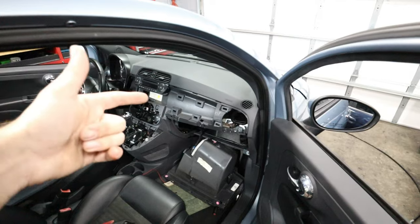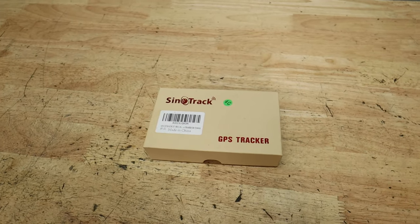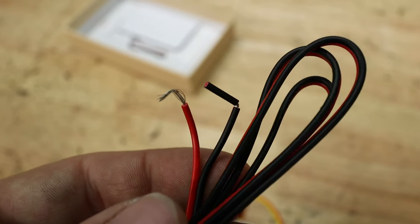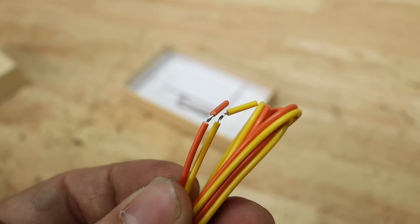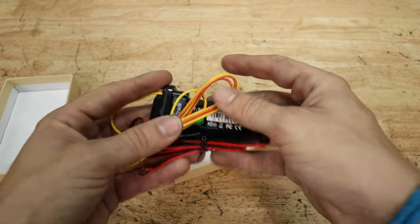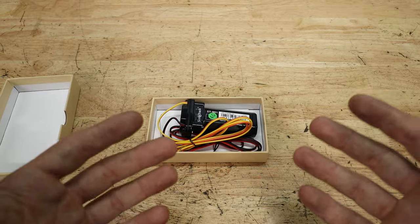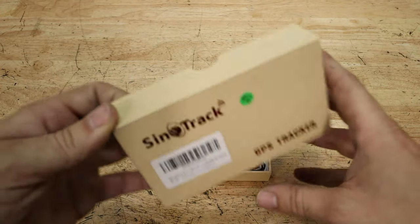If someone did clip some of the wires they found, the tracker still has a battery on board so it's not going to instantly cut out the signal — it should keep transmitting. Not only is this a budget tracker, but it's also very simple to install; it's only got four wires. The two necessary for installation are power and ground — a red and a black wire. Then there's a yellow and orange wire. The yellow one goes to your accessory so you can check when the car is on or off. The orange wire can be wired into a relay for a fuel pump cutoff in case your car gets stolen, so you can cut off the motor completely. That function can only be activated when the car is doing 20 kilometers per hour or lower, so it's limited at high speeds, but when they do park it you can cut off the fuel pump relay and leave the car inoperable.